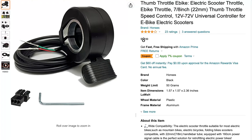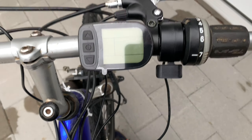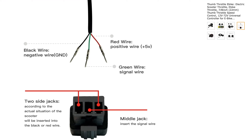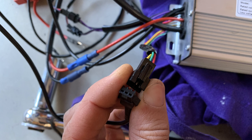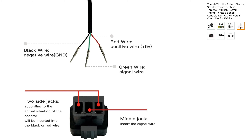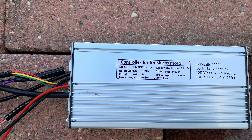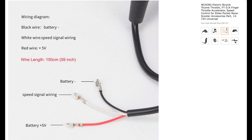The first throttle I bought, I liked the way the thumb mechanism was, and I also liked that it came unwired. There's an SM plug, and you put the wires — the pins — in the order that your control box requires. If you're changing your throttle, there are three pins: hot, ground, and signal. Sometimes the controller box has the male SM plug and the throttle has the female, and sometimes it's reversed. Also, the order of the wires is not always the same — mine was signal on the outside, so it's hot, ground, signal.